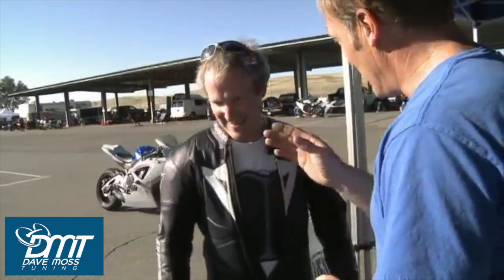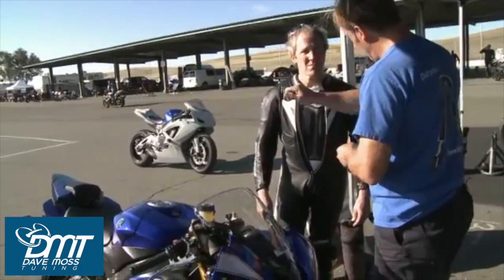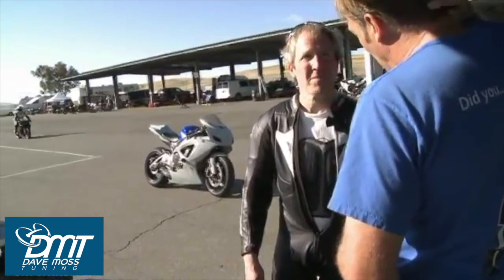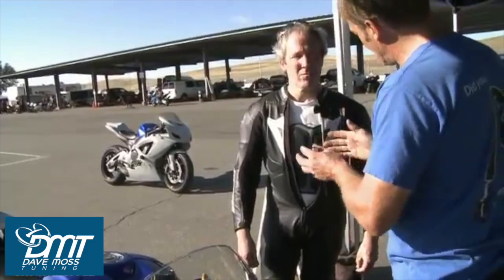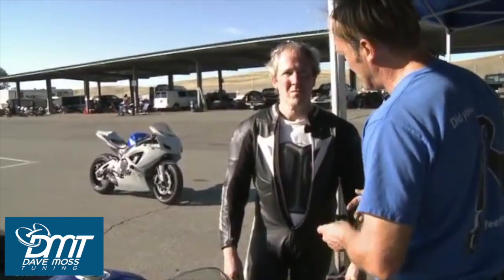So relearn your bike the next session. And then the session after that, effectively your third session, pick the pace up a little bit. You have street tires on. Yep. They take a long time to warm up. So ride appropriately. Every time you're on a straight, gas, brakes, gas, brakes. After 2 laps, you can pick the gas up as you're leaning over, but that's called neutral throttle or maintenance. You can do that, but don't accelerate off the corner until about the 4th lap.